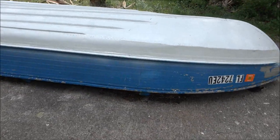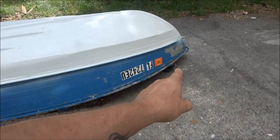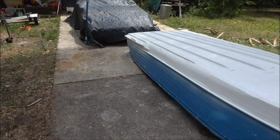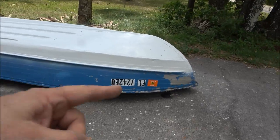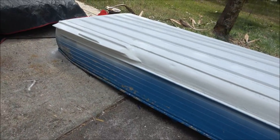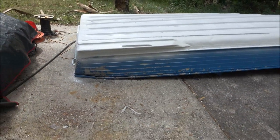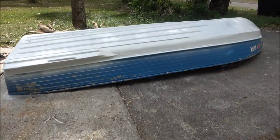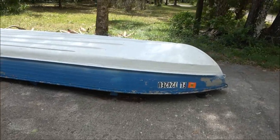There are still a lot more videos coming on this thing. I got a new set of bow lights for it and a new stern light for the back, which is removable but it's wired. That way I can wire it right to the bow lights — the navigation lights — so when I turn them on and off, the stern light will come on and off too. So there we go, it's getting there. We made it white and shiny.